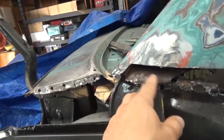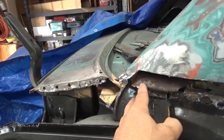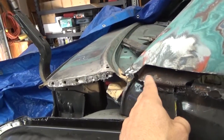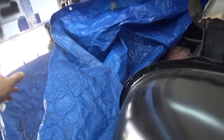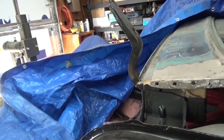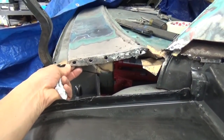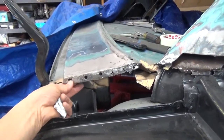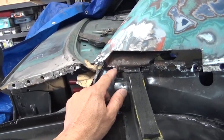So I cleaned this up some more. I fitted the old quarter on here — well, the new old quarter. I guess I forgot to tell you guys I ordered a new quarter panel too. But anyway, I fitted the new quarter back on and it seemed to fit better and closer to this. Still have a problem in the back area. Either way, I'm going to have to wind up cutting that quarter panel on top to get my gap towards the trunk and that back area. But it sure did seem to fit a lot better and closer to this edge — not as far apart as it was, and I wasn't having to force it, clamp it and force it together. It pretty much went on and I just put some clamps there and it looked okay. So yeah, I'm thinking that was the problem.